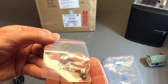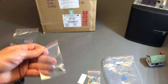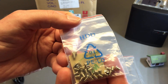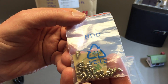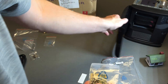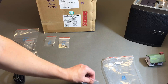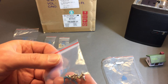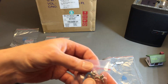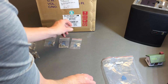This is the motherboard-style screws — only four of them, with a knurled underside. Not really needed because the motherboard is already mounted. Next are hard drive mounts for the 3.5-inch world. If you're going to be using the hot-swap bays, you'll need four screws for each caddy. And finally, 2.5-inch caddies — for SSDs you're going to want those.